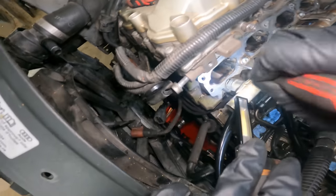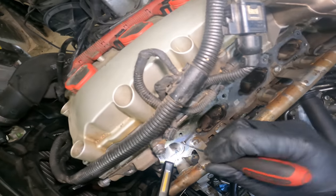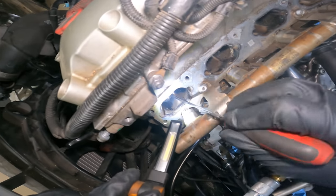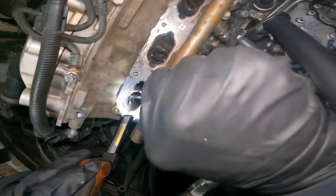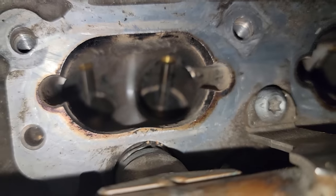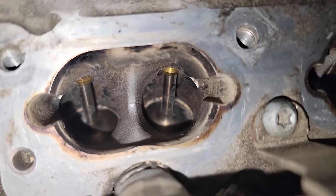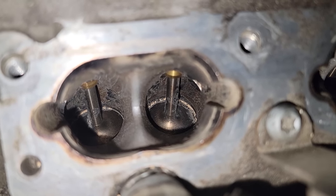See, sometimes the walnuts miss pieces, so I just come back in there with a pick and get those pieces out. Very tedious. All right, so at this point, just with those walnut blasts, that is what we're looking like right now. So we still got a little bit of carbon on there, and if you guys know my channel, you know I'm not gonna leave that there. You could be lazy and do it, but I'm not.